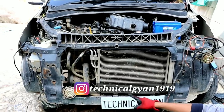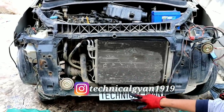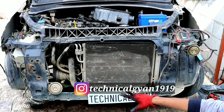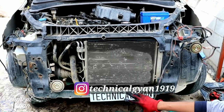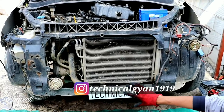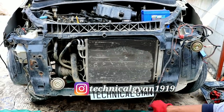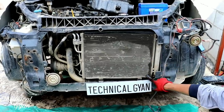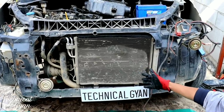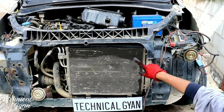We need to test for leakage from the radiator. Sometimes the radiator leaks from the pipe, but because the bumper is not removed normally, it is a very minor drip — so visually you might think it is just a little less coolant and there is no leakage. But physically we can test here — we can see green marks here, because if there is a leakage, the coolant will leave green marks as it escapes.